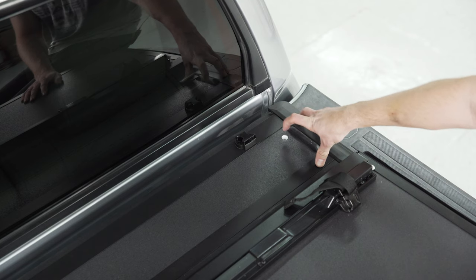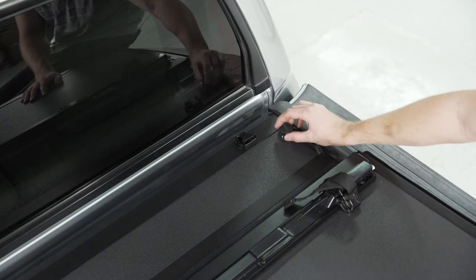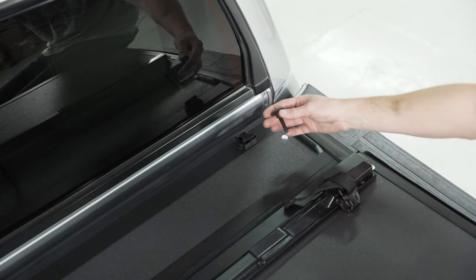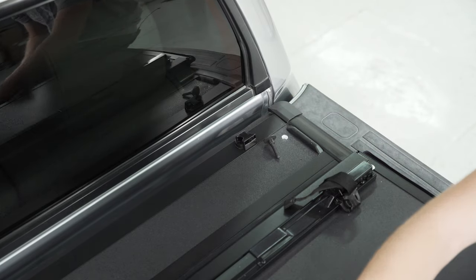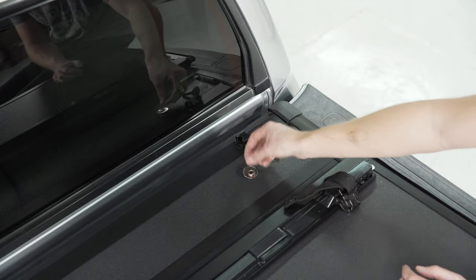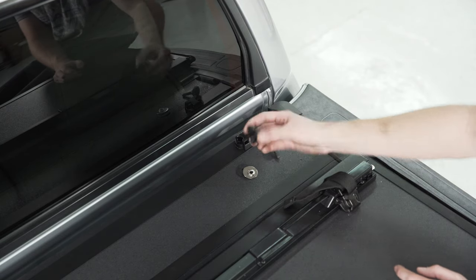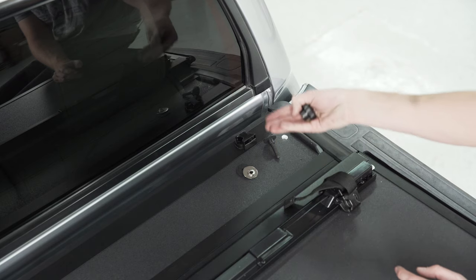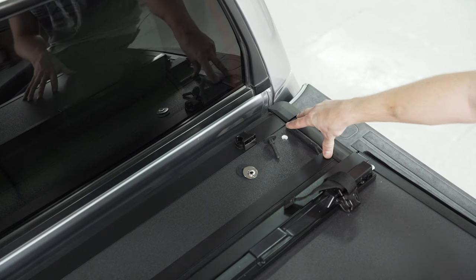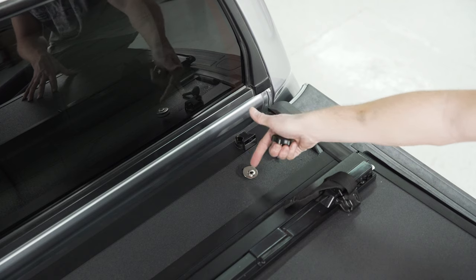To attach the panel down in the corners, you'll see there are some big holes drilled there. You're going to have a peg that goes through the top and sits flush once pushed through. Then come up from the bottom — with that peg you'll have a little rubber seal, a flat fender washer, a lock washer, and a star-shaped twistable knob that you tighten up to pinch the panel to the metal bracket underneath. That's really what gives this a firm attachment point to the truck.